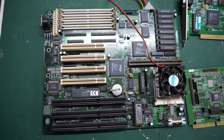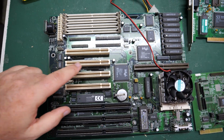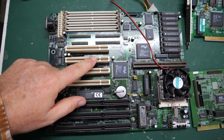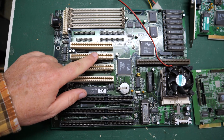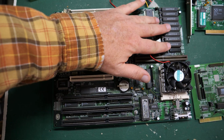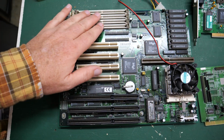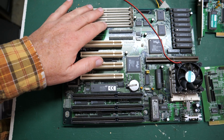All right, I'm going handheld here so we can get a closer look at the motherboard. This is an A-Trend ATC 1535. It says right here in between these 2 connectors. Model motherboard, and it looks pretty capable. It's got some CPU cache over here. It's got 4 slots for 72-pin RAM here, up to 128 megs of RAM.